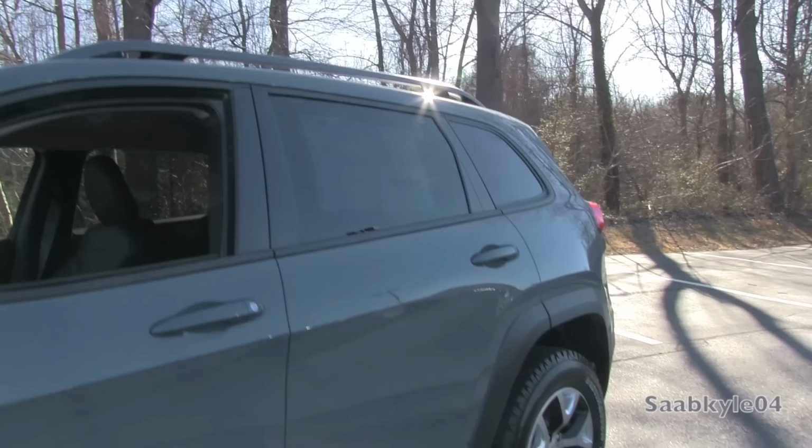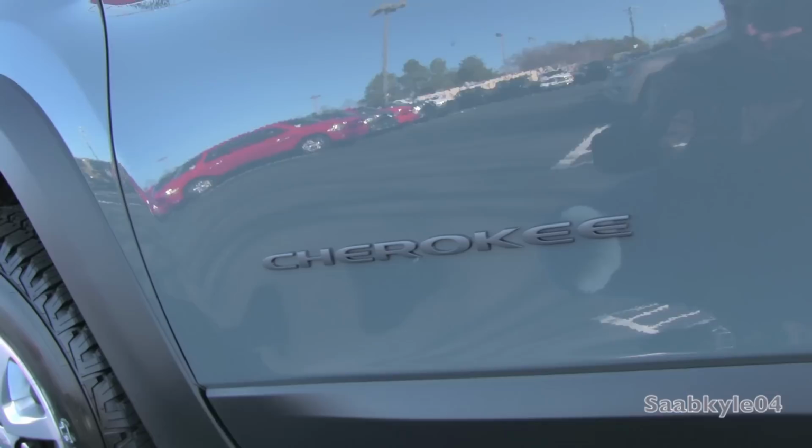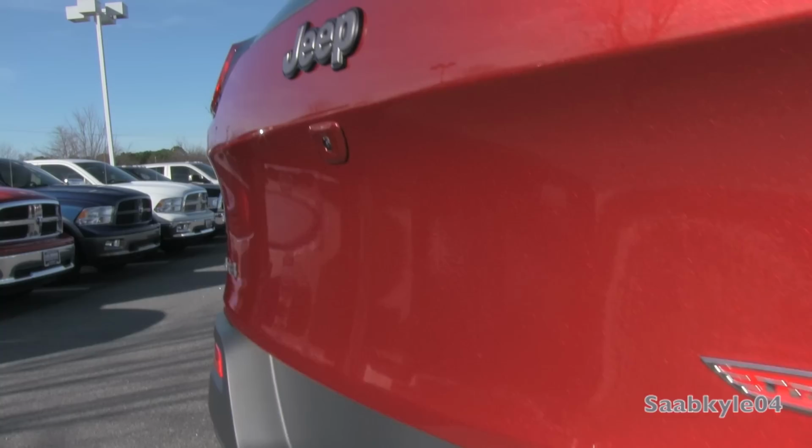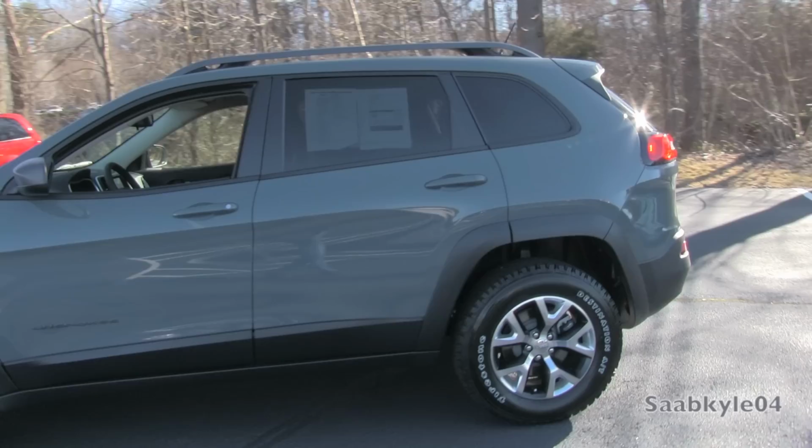As far as construction, the new Cherokee takes more international inspiration over the original XJ. The new Cherokee is also more of a crossover in nature than SUV with unibody construction, along with a chassis that forms the basis of the Dodge Dart, which also has roots with Alfa Romeo. The global utilization of design and construction elements not only help in volume but saves time and money. The chassis itself consists of 65% high-strength steel with a 36% increase in torsional rigidity compared to the Liberty and measures 14,800 foot-pounds per degree of twist.